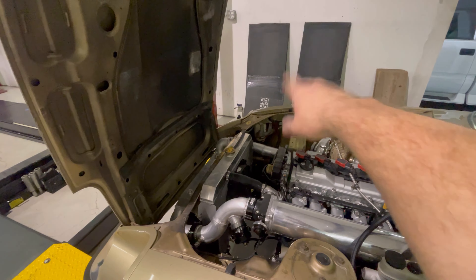I went through and did a full nut-and-bolt check, checked all the fluids. I had that little silicone hose going down to the wastegate and wrapped it in heat-resistant tape because it goes between the dump valve and stuff — I wanted to keep it from melting from heat. Then just a list of miscellaneous little things. Big thing I did: I made a T under the car for the dump valve. So I did a little experiment to see how much the dump valve really does — took a couple of data logs.